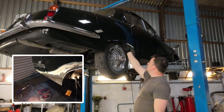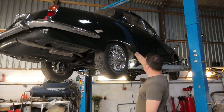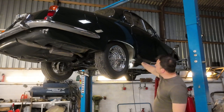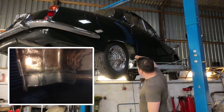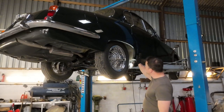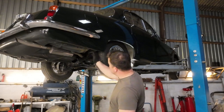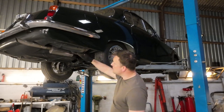Then because you've got a steel flange of an inner steel and an outer wing that also needed work, I got round to the part towards the rear of the back of the door where there was some rot. The wheel arch itself inside is again all steel. The back of the sill has got an inner sill, a middle reinforcer, and then the outer bit you see — those typically go. So I had to cut out and put new plates in there, front and rear. This area also protects the fuel tank, which you can see here held in with straps from underneath.